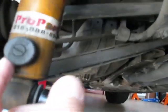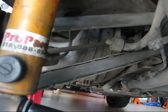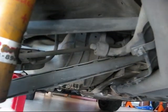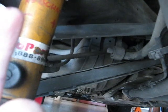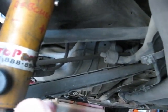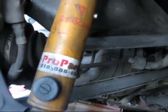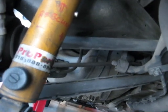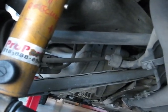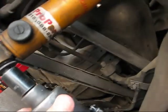With the top loose, let's go around. Froggy's under the car now, with jack stands up — be safe. These are the shocks coming off, built by a company called Pro Parts. They're custom shocks you can't buy off the shelf. This is the bottom adjuster, and the top adjuster is on a shaft at the top. Double-adjustable shocks, very cool for racing — you don't really need them for the street. Going to take off this 18 millimeter on the trailing arm where the bottom of the shock is attached.